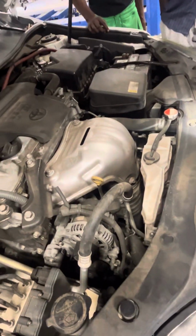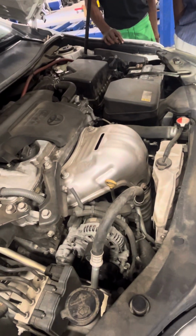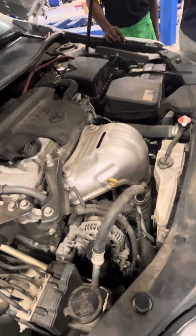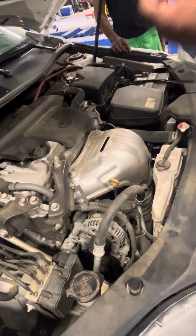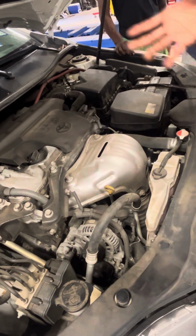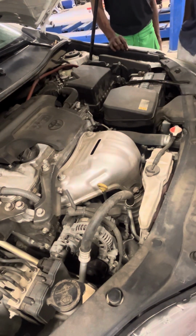So basically, you find the hose, you find the thermostat. You find the hose, you always find the thermostat. It could be the lower or the upper. For example, BMW and Mercedes, they run split. So a hose can wire off to a different section.